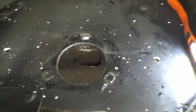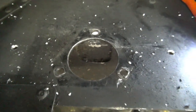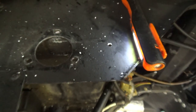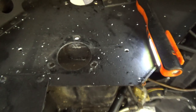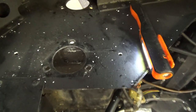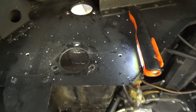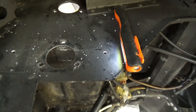Here's a detail of the crack I've got to weld up. I drilled out the ends of the crack with a quarter-inch bit — you could probably go three-sixteenths, maybe even an eighth. The crack stretches all the way across. The way you get these cracks in your bulkhead is by using cheap farm store bearings with the eccentric collar — those always create runout, and the runout makes the flange flex, which is how you get the crack. Don't use those cheap farm store bearings.